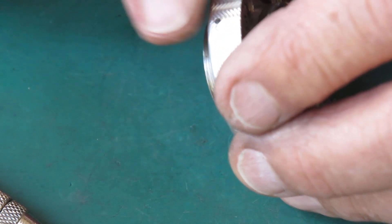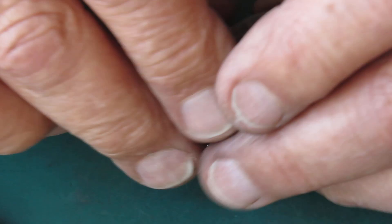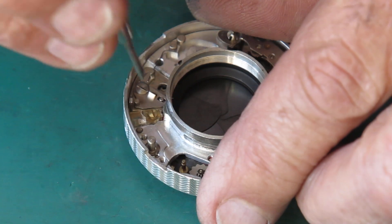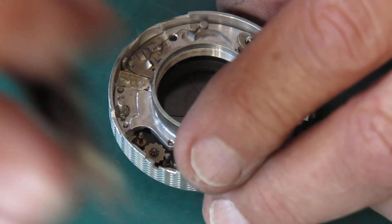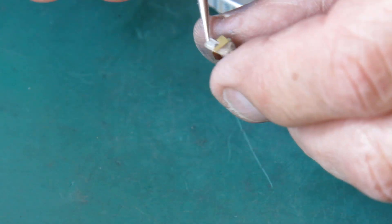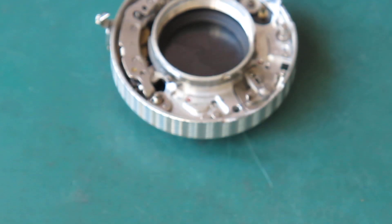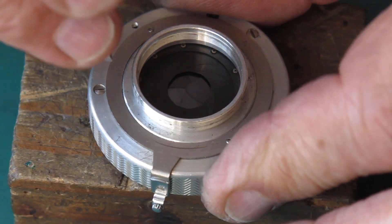There should be a little plastic insulator slug inside that flash contact, so I'll remove the screw. Nothing's falling out — it might still be in place. Back up this screw here and see if we can push the flash contact out of the case. Be very gentle doing this; they're inclined to be fragile. The insulator slug is in place — it's still present and correct. That's a pleasant surprise. If it's not there, it means the flash wouldn't have worked because it would have been shorted out.